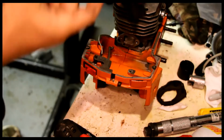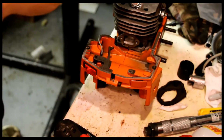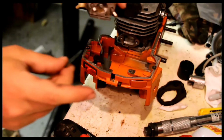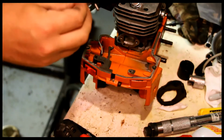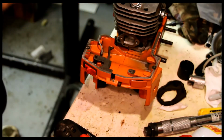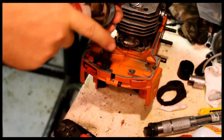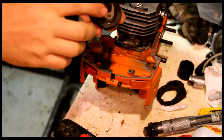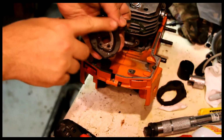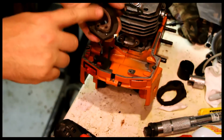This particular gasket is going to go up against the carb here, which, suffice it to say, I've taken this apart and cleaned. I did not kit this particular one, mostly because I don't have a kit, but this one is quite clean inside. Now I've got all the goop on there, the 515. I'm going to put that gasket on there. Again, sealant kind of everywhere. Don't want it in the intake, but a leak here is a very bad thing.